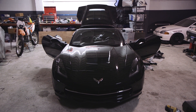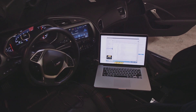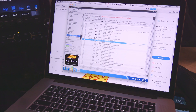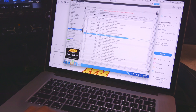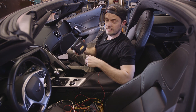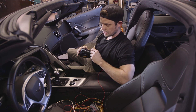Once you install it, it's as simple as plugging it into your PC that's loaded with the AAMnet software — it's free and super simple to use. You plug it in and it's going to tell you what channels are available in the car and what data it's seeing from the CAN bus. You pick which ones you want, and in some circumstances you can pick a data rate that you want to log at. This thing will log at a thousand hertz — that means a thousand bits of data per second — and it comes with a two gigabyte card, so you've got plenty of storage.